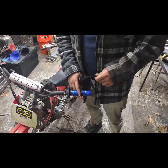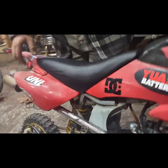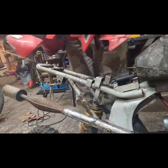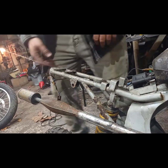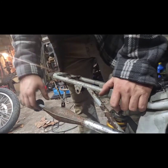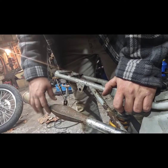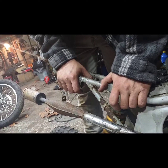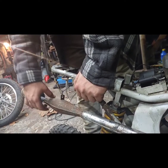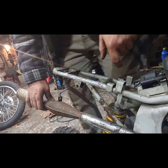It's a dual sport, so you've got to do wild stuff with it. We'll get the clutch lever back on there. We're going to do the kill switch. We're also going to modify the exhaust — I already prepped and took the screws out to pull the plastics off. This is a pipe I modified a long time ago from a motorized bicycle because the original pipe was annoying as hell, really loud and obnoxious. I actually feel like it got a little bit faster by closing the exhaust up, because I'm sure they didn't jet it when they put the bigger exhaust on it.